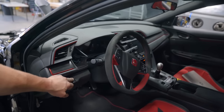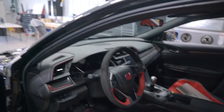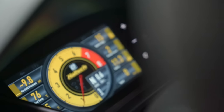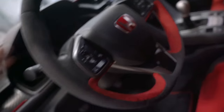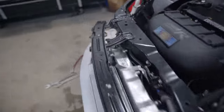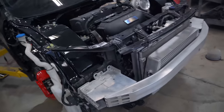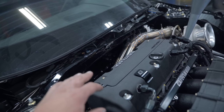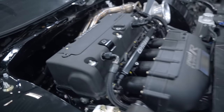It does still need some tuning work, but so much better. The first thing I'm gonna tackle is the alternator — we're at 11.4 volts, which means it's not charging. I'm assuming it's pinned wrong, being that we've had this harness apart a couple times. I want to pull the plug, check the pin, make sure that's good to go, plug it back in, and it should be fixed. We also have three AN fitting leaks all in the cooling system — I kind of cheaped out and bought some cheap eBay ones, and yep, they leak. May have to order a new set.